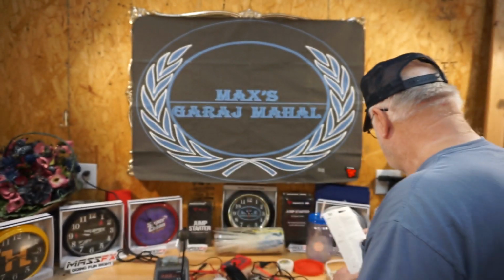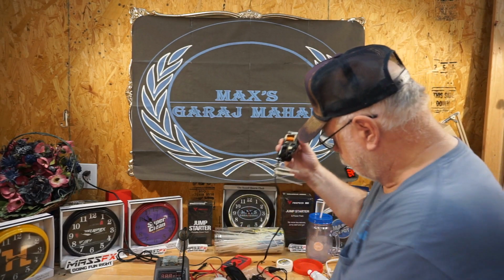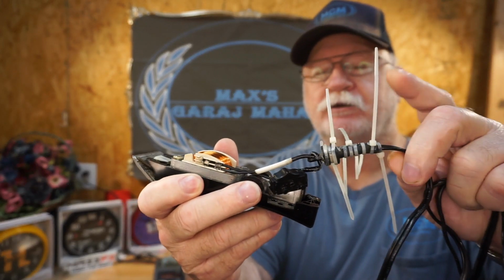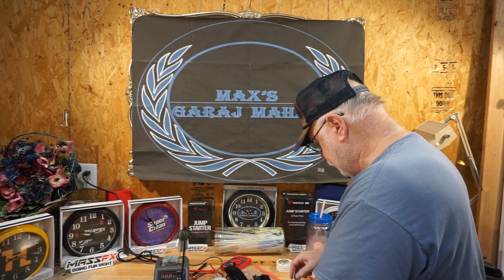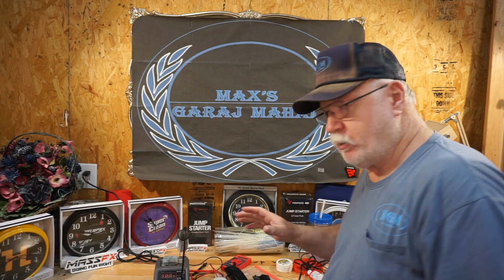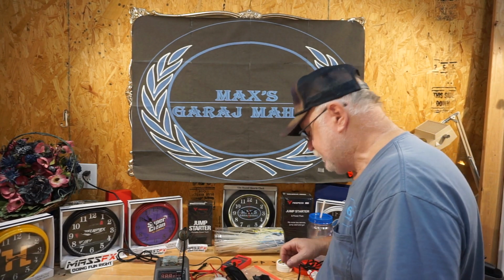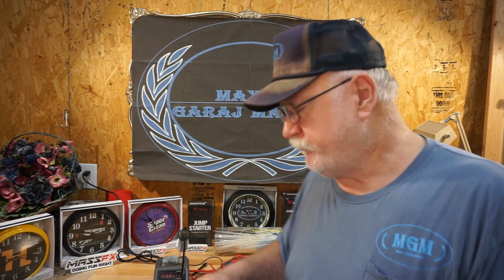Shoe glue to reinstall the strain relief. And I used zip ties in order to keep that compressed until those harden up and that thing won't come back off. So I'm going to stop the film. You're used to me stopping the film here. I'm going to remove a few of these zip ties, just enough where I can get the clipper put back together. We'll plug it in and see if moving that around stops the machine.